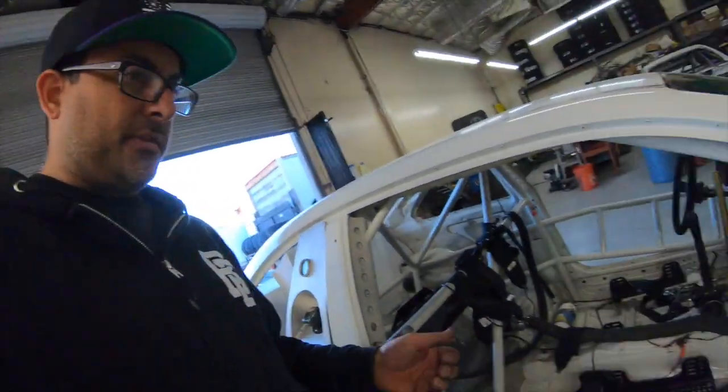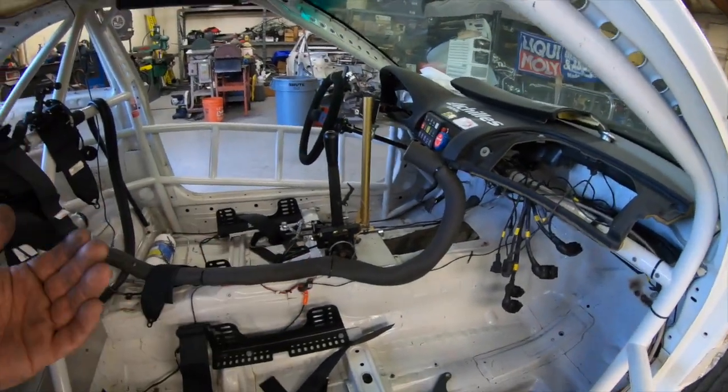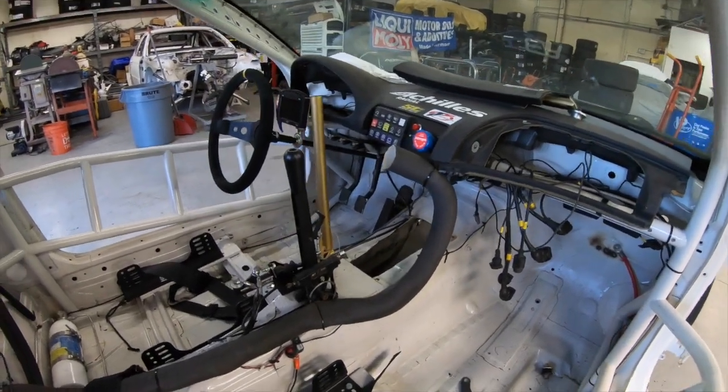So that helps. And with the pass-through master cylinder, getting back to that, you don't have big feedback. If you use it in a stock street car with a single master cylinder, you might have a lot of feedback. When you're pushing on the brake, you pull the e-brake, and you get this big pulse. So you pull on the e-brake handle, and it kind of kicks the brake pedal back at you. But we don't have that problem when you're running big master cylinders on a dual pedal setup.